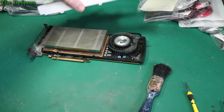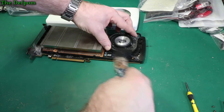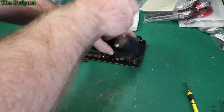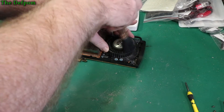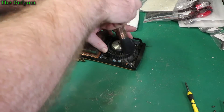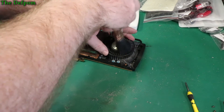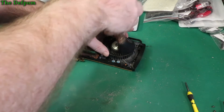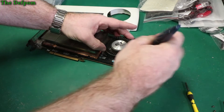That's pretty much the case of reversing the process now. There's still a bit of dust in those fans — get that out of there. Sometimes it can be a bit stubborn, especially if it's very humid. Humidity is actually quite bad because it can make dust stick together. When you've got a lot of dust build up on electronics — especially in power supplies — and a lot of humidity, it can make the dust start to conduct and become a short circuit or a low resistance, causing all kinds of problems and potentially blowing them up.